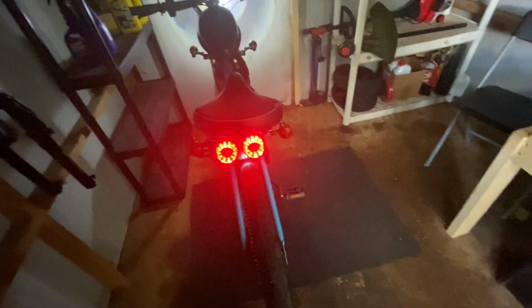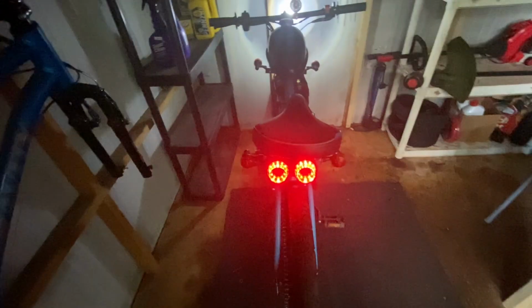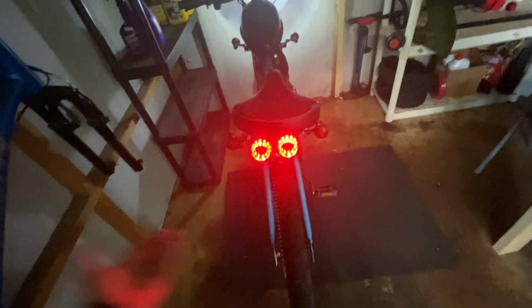But here's the thing. On these bicycles, there is a common problem. You look at this one, this is a mountain bike. It's got a fork and a chainstay that goes out, and it's wider here than it is up here. If you try to mount an engine to this and put a chain tensioner on this chainstay, you're going to have a discrepancy. It's not going to be in line. That's the number one reason. Nobody will say that's why, but that's why they don't recommend them. They don't understand the reason why. They just don't want people to use chain tensioners.